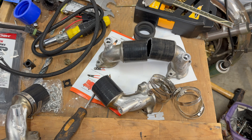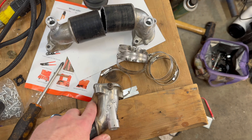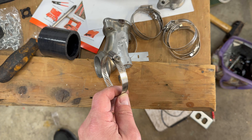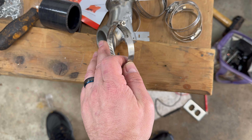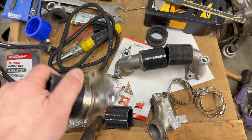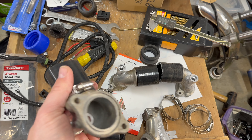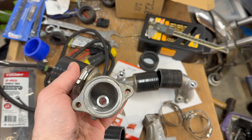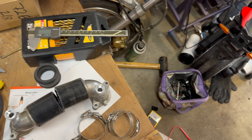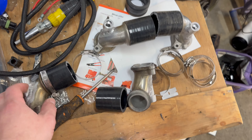Got these hose clamps. As you can see, there's not a whole lot to grab onto but it's enough — they're about as wide as the hose clamps. Most of the hose clamp will cover most of that, so it's on there pretty good. I'm not going to be running boost, so it should be fine. One thing I need to do is get a carbide bit and grind out the excess, because these bungs were pretty long. I need to grind out the part sticking inside the port and blocking a quarter of it. That's on my to-do list — right now I'm just mocking things up.